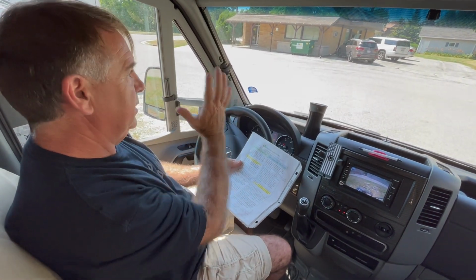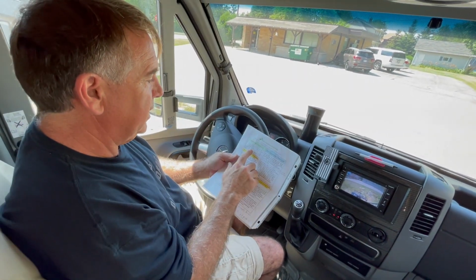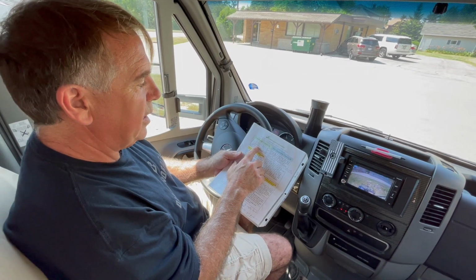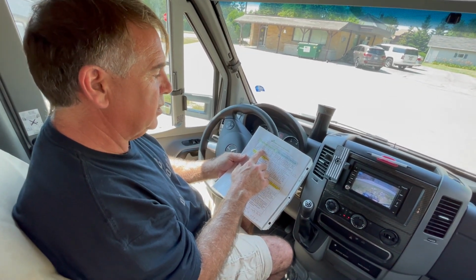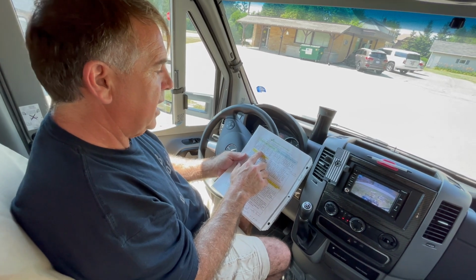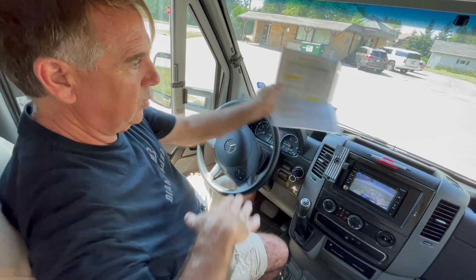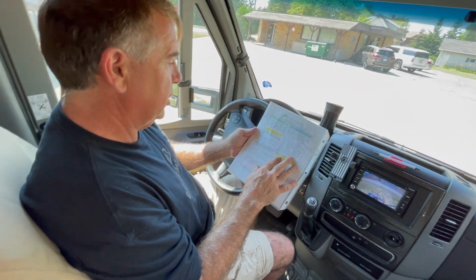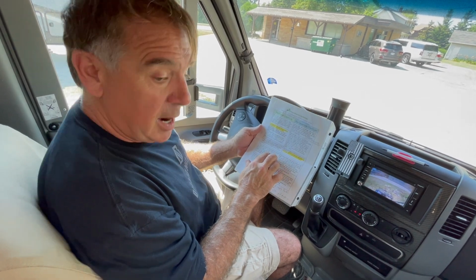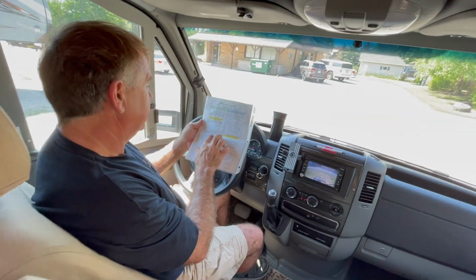You're going to want to have at least 3 feet on that side of the motorhome so that it doesn't hit anything. You're going to use your leveling blocks if you want, and again, those are stored in the passenger side rear compartment. You may need to set it up in a step pattern to raise either the front or the side, depending on what your level is. There are level gauges down on the floor level there. That'll tell you if you're tilted front to back, side to side.